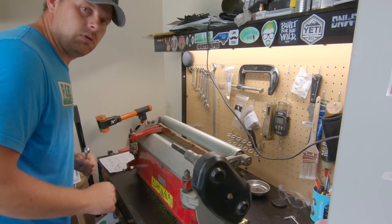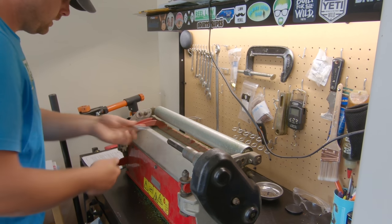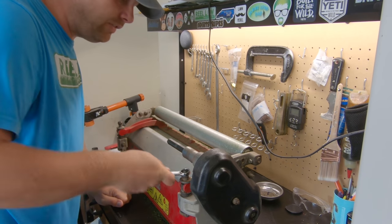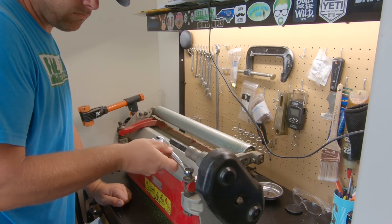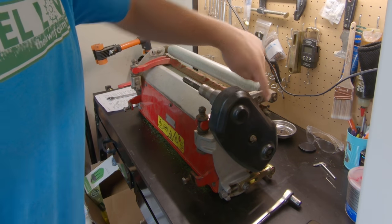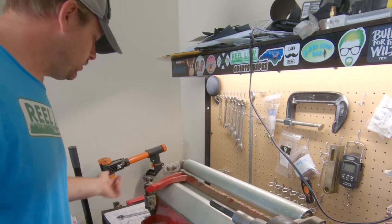Okay, we can get back to taking things apart — just had to clear that up. Once the adjustment screws are loosened all the way, we have to back the tension off these two nuts here with a 17 millimeter. Then we have this piece — there's a matching one on the other side. There are some plastic washers back in here, and more on the other side. These are very, very important — do not lose them. These take a 19 millimeter.